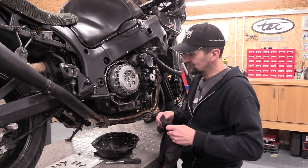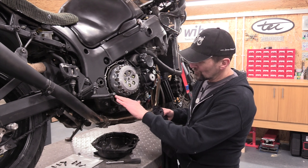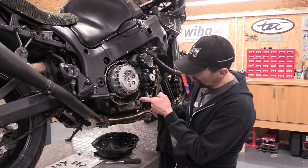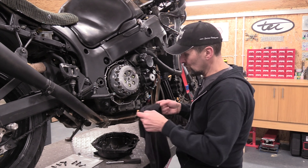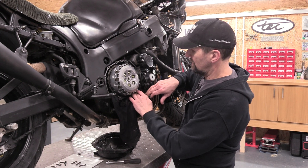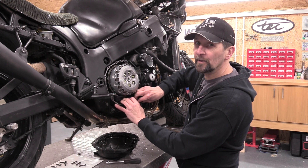Right, at this point the bike is on the side stand so no oil leaks out. You've still got a great big open cavity there — as you can see looking down there, there are some big scary holes that go through to the sump and even further back they go through to the gearbox itself. So I take the precaution of putting a rag in that space — feed it all in until it's full, tuck a nice clean rag in there and fill up that cavity.